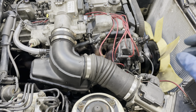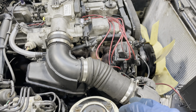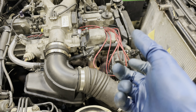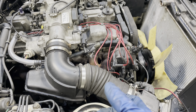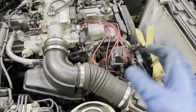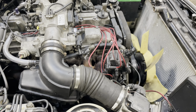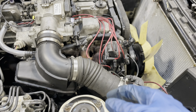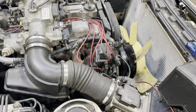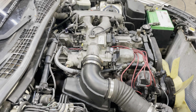So I pull off all the wiring, pull off the cap, and put everything to zero. I reline it up, mark it. Before I lined it up, I hadn't even taken the cap off — I just kind of tossed it in there. I watched a video and for some reason the rotor goes really far to the right. I'm not that familiar with distributors. So I lined it up with the mark, this time with the cap off. It was still giving me a hard time — I couldn't get it to line up with the line on the outside. That was already telling me it could have been way out of timing. Anyways, lined it up, put everything back together, and cranked it on. And that's what you're about to see now.